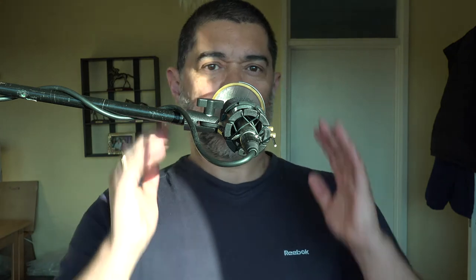Now, the reason for that is because the closer you get to this microphone with, say, something like a voice, which is carrying wind and stuff, it's going to accentuate the bass end of this capsule, and you can go a bit too far with it as well. I think the way I've got this and the input into the camera off the Saramonic, it's probably balanced fairly optimally for this type of distance and whatnot.